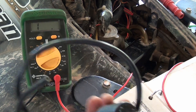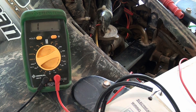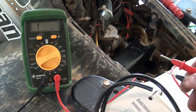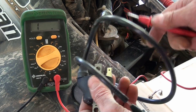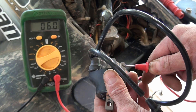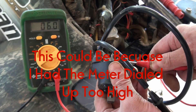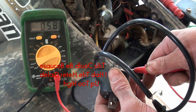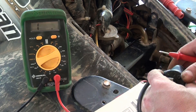Just for the sake of follow-through, here's another coil I got for $20 on eBay with the cap — and the cap was bad on mine. I was taking a chance on it, but it ended up the coil was good, so I've got a good spare coil with a bad cap. This coil also reads right at 6,000 ohms. So I'm not overly concerned that the existing coil in my machine is only at 6,000 because here's another coil that also shows 6,000 — it's supposed to be 6,300.